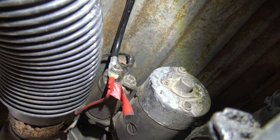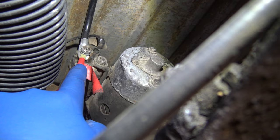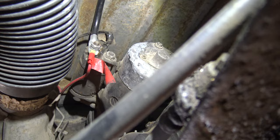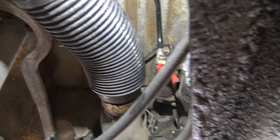Okay guys, we're now underneath the car. You can see the starter there — we'll disconnect the cable right here, that's a 13 millimeter nut, and then these other two wires here. And then we'll go ahead and pull these heat tubes out that go from the heat exchanger over to the body. We'll take those out on both sides.